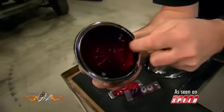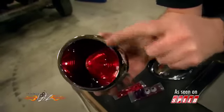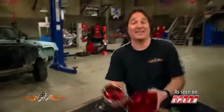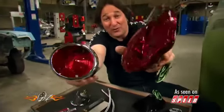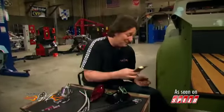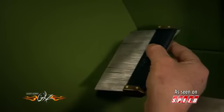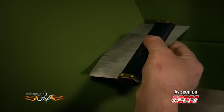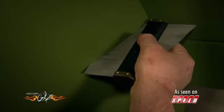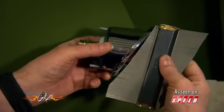These are really slick — they have the recessed bullet lens and the chrome bezel, and they're just going to look awesome. The problem is these are worlds apart, so how do I know something like that's going to fit? By using a contour gauge, we were able to determine that the angle of the rear fender is an almost exact match to the '63 to '67 inboard Corvette tail light.